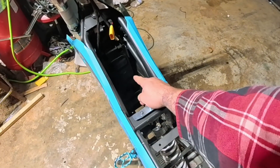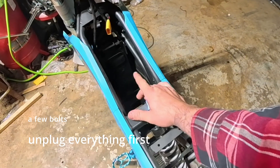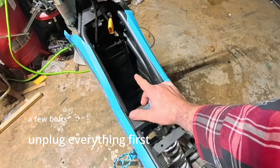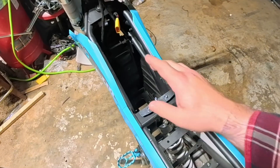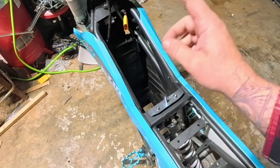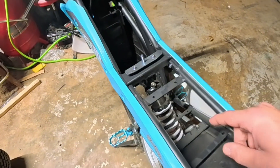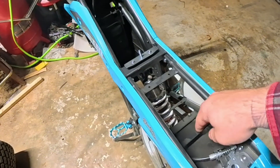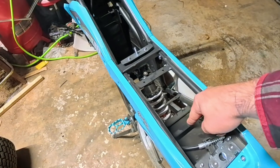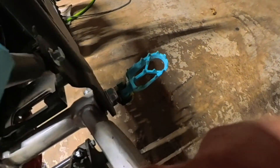Right here is the stock controller for the 60 volt, 20 amp hour RTR Lite. There are four bracket bolts on there. You're going to take those four off after you've pulled the battery out. You're going to disconnect the motor and everything else from the controller. The new kit comes with a plate to cover that spot, because the new location for the controller is back here — for the Truemoto 13 kilowatt peak version that you can set up and connect to your phone. Then the motor down here only takes a few bolts — one over there and a few over here on this side.